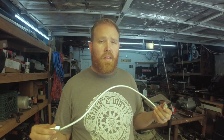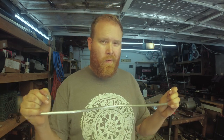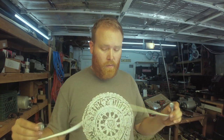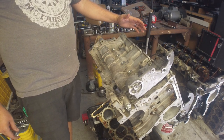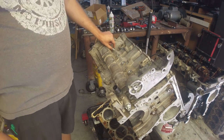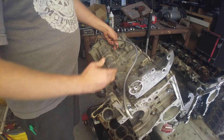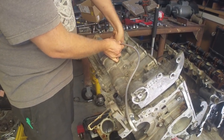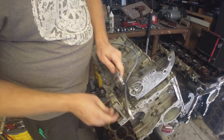I'm going to send you guys a flex line with the ends already crimped on. It'll be kind of coiled up in the box with the ends bent the way you need, but it won't fit exactly out of the box — plus that way I can sell the kit regardless of what motor you have. This will work for the four-cylinder 2.8 and 2.9, the 3.7, the 3.5 five-cylinder, and the 4.2 six-cylinder with the same setup. In order to do this in-truck you're going to need to take your intake out and the exhaust manifold — I'll link those videos at the end. We're going to take our semi pre-bent line, hook it up on the front end, and pass it through the side of the motor.